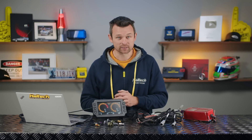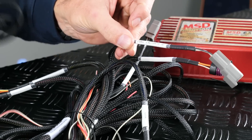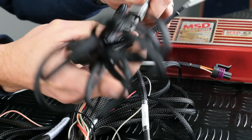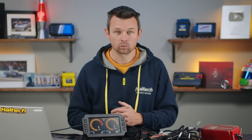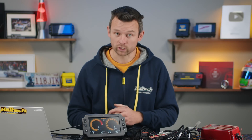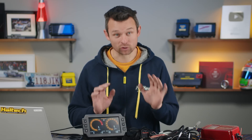Looking a little deeper at the wiring harness, there's also input wires for a fuel level input — and there's a connector in the middle of it, because you may already have a wire that runs all the way to the back of your dash for the fuel level, or you may need this long wire to get all the way to the back of the vehicle where the sender is in the tank. Both situations are catered for here. We've got a tach input wire which wires to either the negative post of your coil, or if you're using a CDI like this MSD6A, connect it to the tach output wire of the CDI. This is really important — you do not want to connect the dash directly to the coil if you're using a CDI unit. Use the output from the CDI.